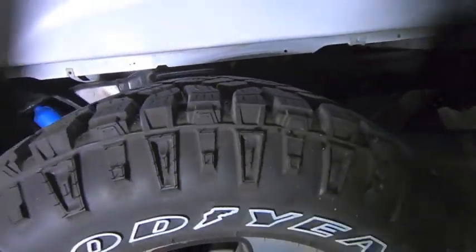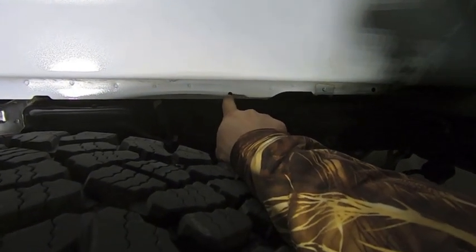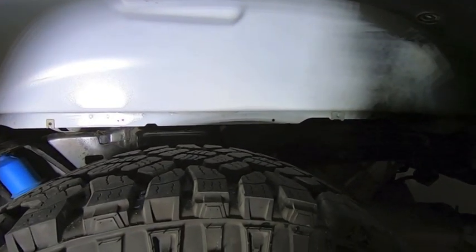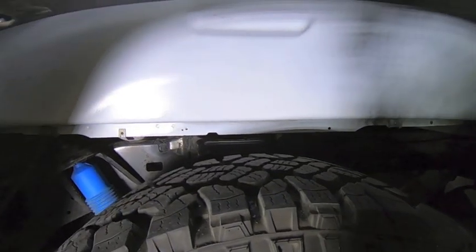So let's go ahead and remove those metal tabs. Then we could repurpose one of those tabs for this back hole right here, because now with the liner, we're gonna have a screw here, a screw there to hold everything on, to make sure everything's held down nice and tight. So let's go ahead and do that and then get everything lined up to get that rear wheel liner in.